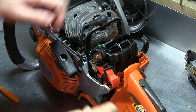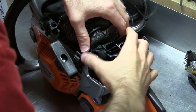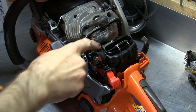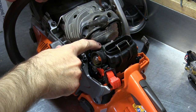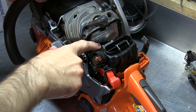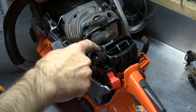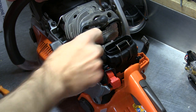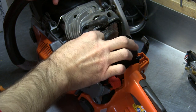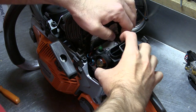I'll take a pause here and unclip these little standoffs. I already pulled the screws out. One other thing — you see these little green washers I have here. You probably don't need three of them, just one. I was having an issue with sealing and had the carb on and off a few times. I put a couple of refrigeration o-rings on to increase the clamping, because a few times I put it back on it wouldn't pump fuel. These fuel lines — I'm not a fan of them. They're very pliable, they get hot and become almost like silicone rubber instead of a harder, tougher rubber.